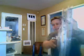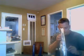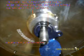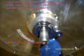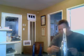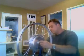If you look at this, you'll see when you get yours, the bolts on the hub motor are flattened off so they fit right into the notch onto the dropouts on your forks. So let's have a look here. I didn't measure any of this. So we're just going to kind of wing it and see if we can use the washers or not. We need to turn this upward so that the flat is facing downward. Just double check our widths here.